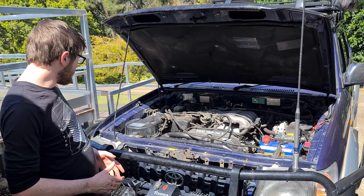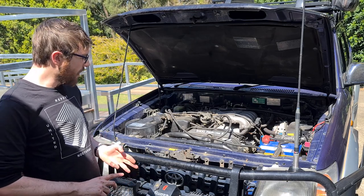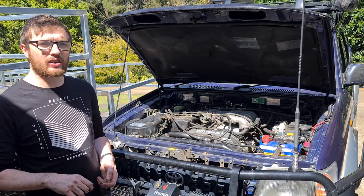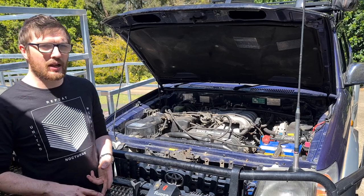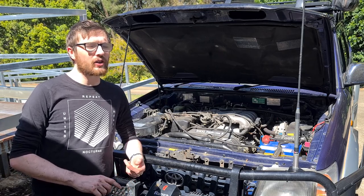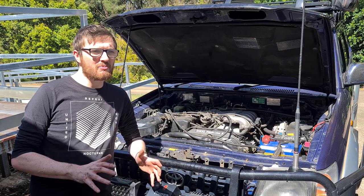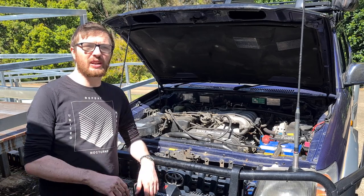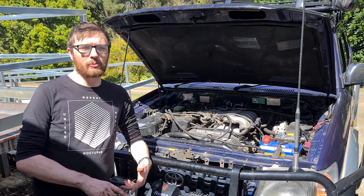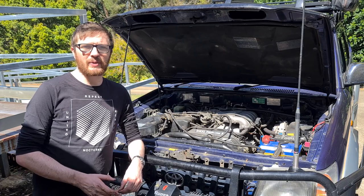Thanks for watching today team. We replaced the air filter, the oil filter and the oil with fresh 10W40 from Penrite. We also checked the car for leaks and found that the bottom radiator hose had a small leak because it wasn't done up tight enough, and the sump plug also wasn't done up tight enough so it had a very small leak. The sump gasket appears to be weeping — not a massive issue but I'd like to have it fixed eventually. I'll check in again after maybe 100 k's to see if there are any leaks, missing coolant or oil, and top up if needed.